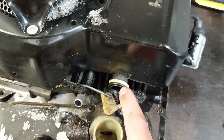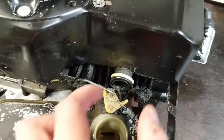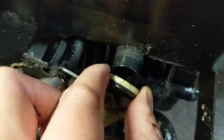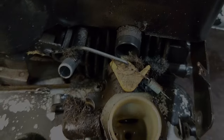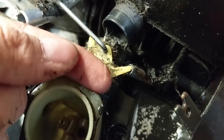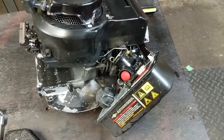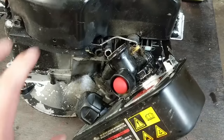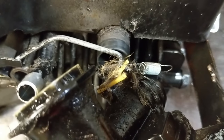I did a video on replacing a cracked intake manifold — I'll link it in the top right of your screen. Sometimes on the plastic ones they can crack and then your machine can hunt. You guys can see there's going to be an o-ring and a white plastic retainer — go ahead and pull that off and put it to the side. The trick is going to be to get the throttle lever off of the throttle linkage. The throttle linkage goes down and then comes back out, so all you want to do is pull that and then twist. When this engine is mounted to a mower deck there's normally a little extra room to twist that down, but because I have it on my table I have to lift the engine up. You're going to pull the fuel tank and the carburetor down with that linkage up, then rotate it and slide it off.